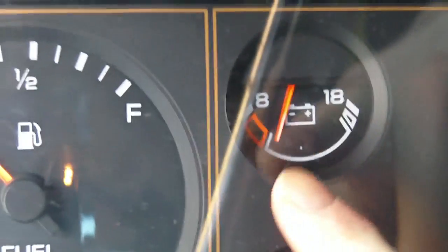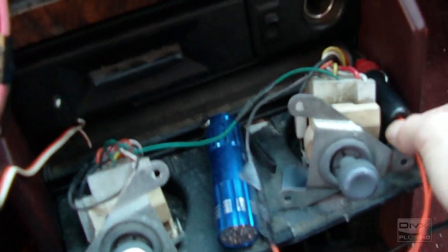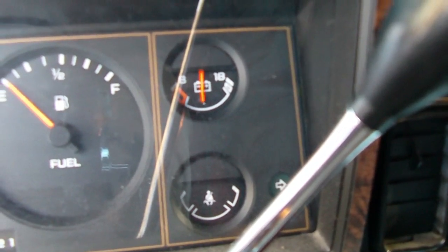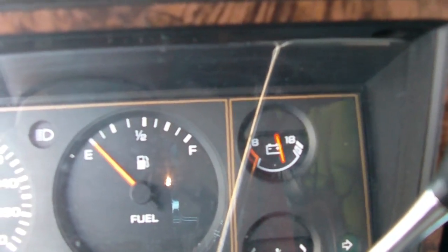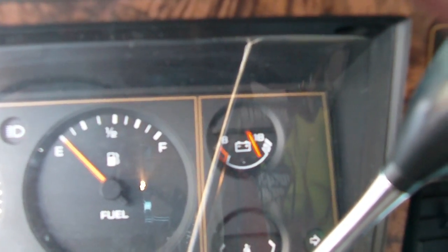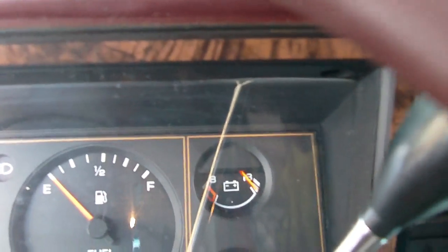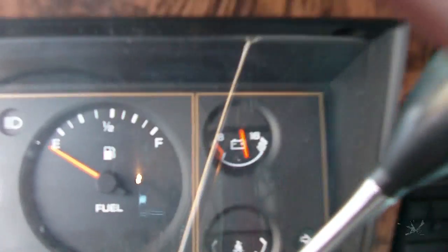Okay, and then now you can see the voltage here is completely, it's not charging at all. So if I use the original alternator with the manually controlled field voltage, then I just plug this in here, and then I can just turn up these knobs and you'll see that there it goes, right? And then I can just adjust the voltage with the rheostat, so you can see that it climbs up, and there you go. But it doesn't maintain very well. It does work, but watch, if I throttle the gas, then the voltage spikes. So possibly if you wanted to, you could run this off of another battery that has just a steady voltage. Manually controlling the alternator is a pain. But it does work. It will get you out of a jam.